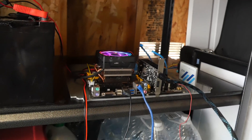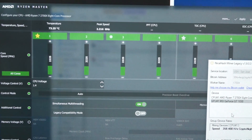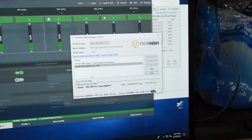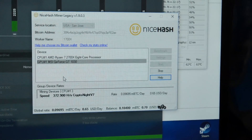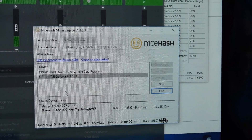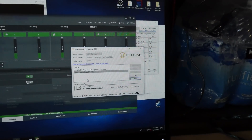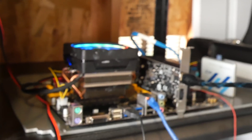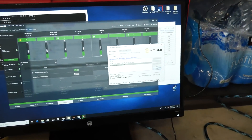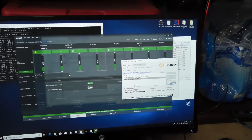What I managed to do is underclock the cores to 2,225 MHz each so the power draw isn't too much for this little power supply. I'm mining at 372 hashes per second, which is pretty high — about 68-70 cents per day. The cables don't get too hot, just slightly warm, which gives me more assurance this will work long-term. Now I'm going to install the solar panels so I can keep charging those batteries while mining — the solar panels will be hooked up in series.